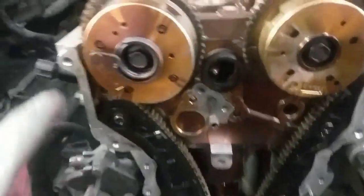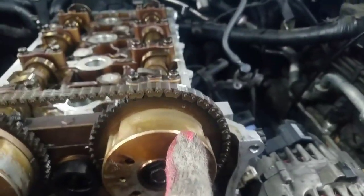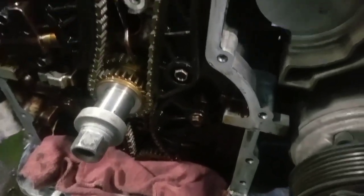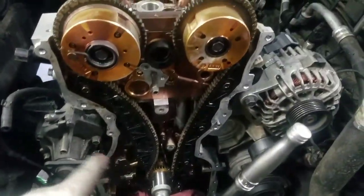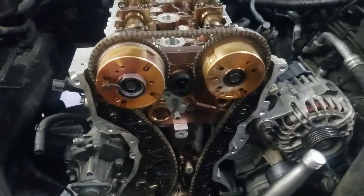As you can see, already put the timing. You see this dot here — you see the different sprockets, it's kind of darker, that's the way it's supposed to go, as you can see this one here too. And the same thing on the crank — that's the timing marks. After finishing the timing, we're going to make at least two turns so we can see everything is OK.